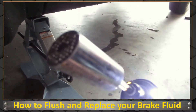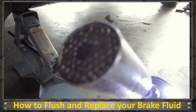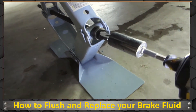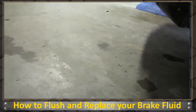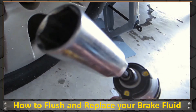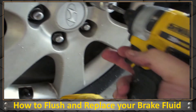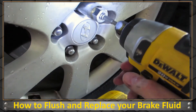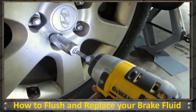To speed up the process of moving these jacks — since they're manual — I use a socket with all those pins in it and put it on my drill. Then I switch to the drill with the large spark plug socket. I loosen the bolts with my wrench first, then use the drill to get them off the rest of the way. It saves a lot of time.